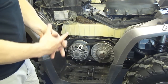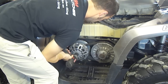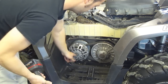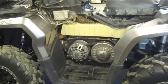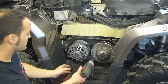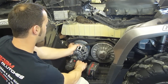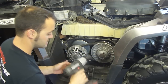You've got your primary and secondary — looks identical as it has on all the Can-Ams since 2005. You need a 19mm or 3/4 inch to pull the primary bolt out. Since this primary didn't pop off while I had the bolt out, that means the taper is stuck. Take a smaller rubber mallet and tap it — the spring tension will push it off. If the primary stays stuck and you take the bolt completely out, it will shoot across the room. So be sure if it stays stuck to use your mallet to bump it off before you pull the bolt all the way out, because it's got a pretty good bit of spring tension.